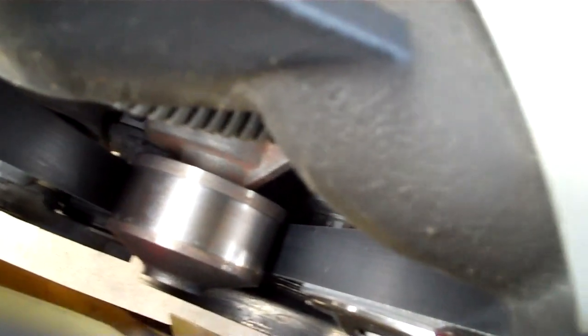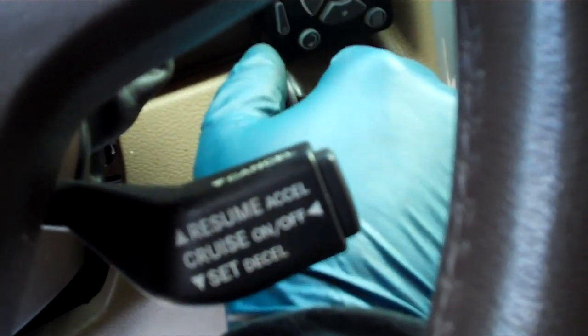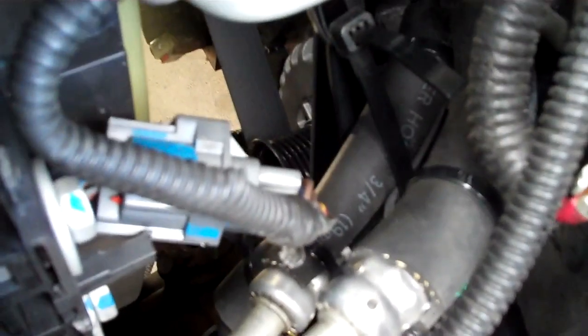I check up here and it looks like I'm good on my power steering pulley, good on the idler — both grooved and smooth — and good on the water pump. Everything looks good. Here's one more look at the diagram if you need it. Let's go ahead and fire it up and see how we did. I don't hear any whacking or thwapping or any other kind of sounds. I'm feeling that the belt is holding strong and stable.